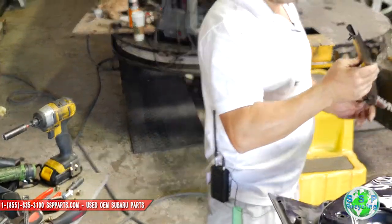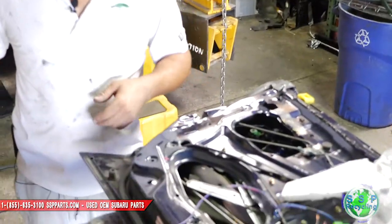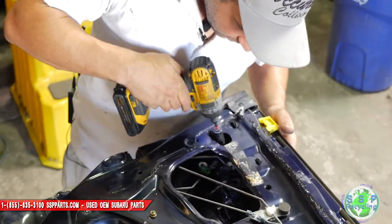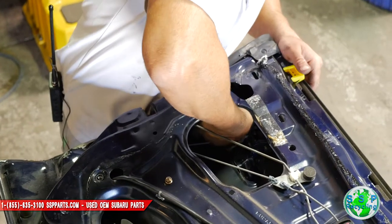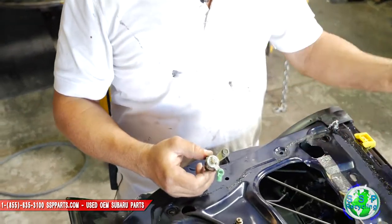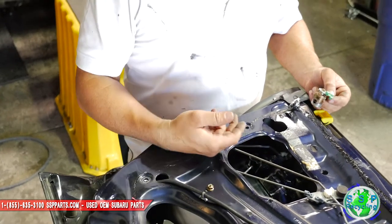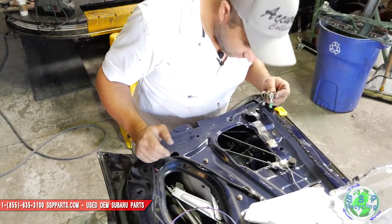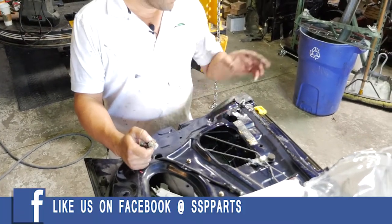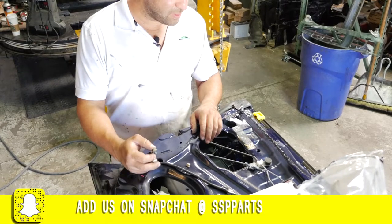You have to remove that track to get to the 10mm that holds that lock cylinder in place. I purposely don't need this so I'm gonna throw it away because I have one on that other car. There's the 10mm — what I've been waiting for. There's your lock cylinder and there's the number 10 that holds it. In order to get to that 10 you got to pull the glass out and pull the track out on this side. You'd have to be a really tiny person to sneak underneath all that otherwise. So I've got everything out that I need — now I have to do the same to that door to put it all back together. Usually the way it comes out is the way it goes back in.